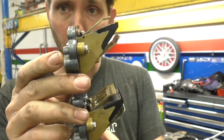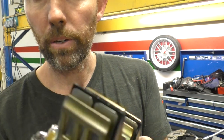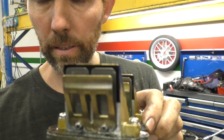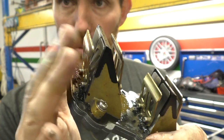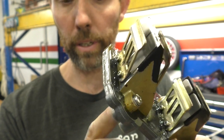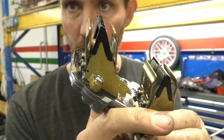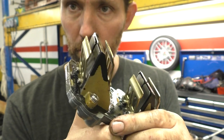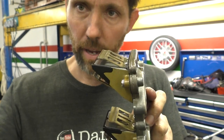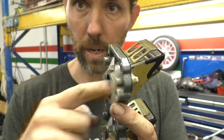So here's what they look like — one set for each cylinder. The valves themselves are these little metal plates. They can open from the inside, and there's a metal barrier that stops them over-extending and opening too far. Air comes in through the carburetor and as it comes in it opens the valves, but the valves can't open the other way. As the air pressurizes it actually forces them closed, so it only allows air and fuel mixture to come in this way, not to escape back out.